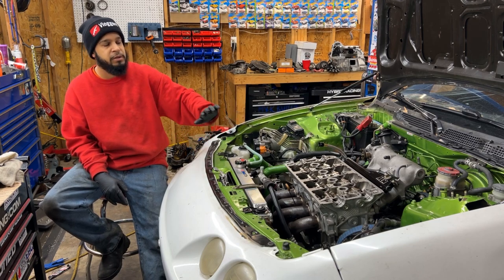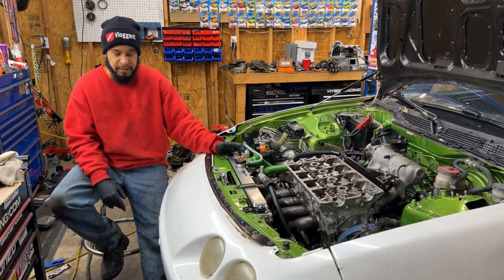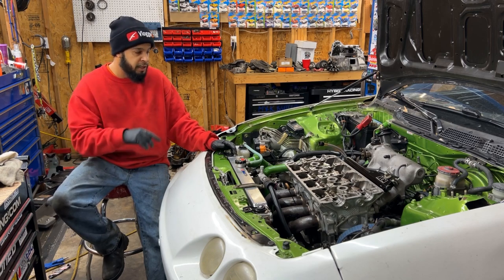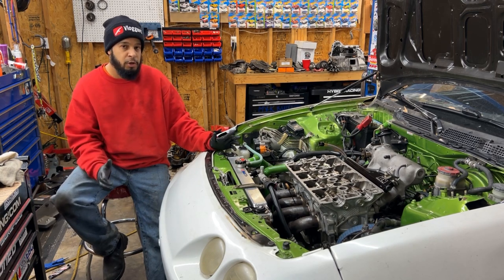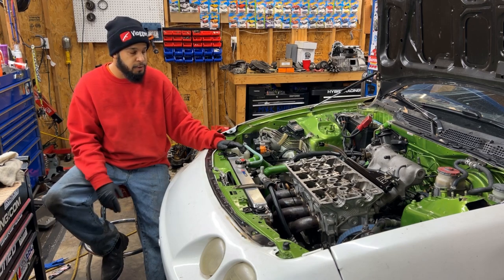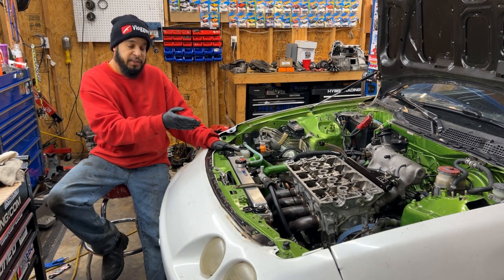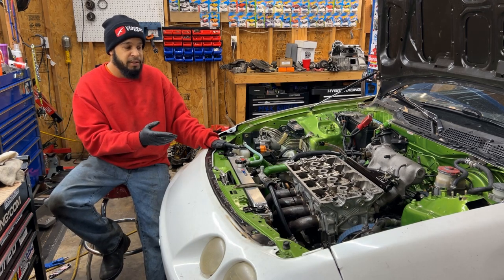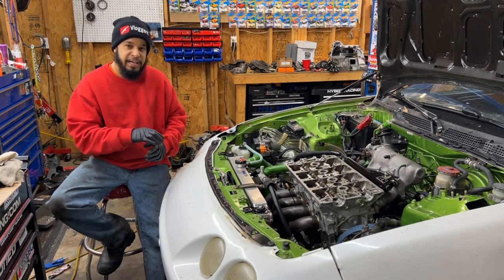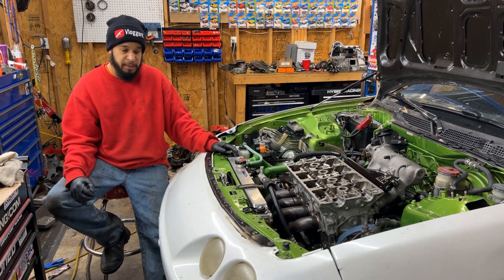Just a lot of stuff was wrong with the whole setup. A big thing I did notice, I took lots of pics of that as well. I was going to throw some Pro 1 camshafts in here, which are a lot bigger than the GSR cams it's running right now. In order to do larger cams, I was going to have to do some work on the pistons to make sure there were no valve to piston clearance issues. But when I had the head off and I was looking at the tops of the pistons, there was already contact between the valves and the pistons with the GSR cams in there. And I found that the pistons used for the build were stock replacement B20 pistons, but the cast was just not exactly the same as OEM. I think that was causing it to already hit regardless, because of the reliefs.